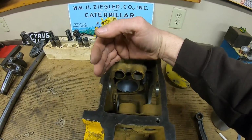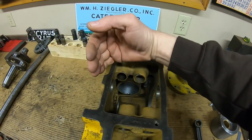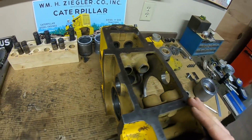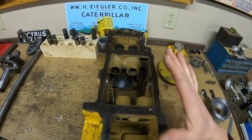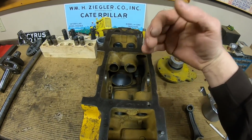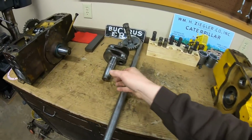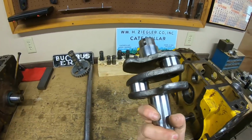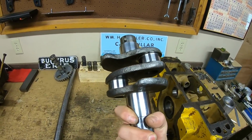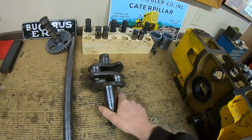So each main bearing will only have crank thrust that's trying to force it outward, and we're going to remove the inward pull off of this skinny little poor front main. So that should be a much more stable end thrust arrangement than what came on this from the factory. And I know, even though these are hollow journal cranks on the rods, I know of other people that have split the thrust evenly between front main, rear main, and so far they've held up just fine. We haven't had any cracking or breakage or anything like that going on.